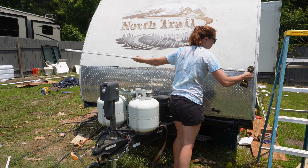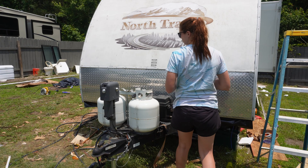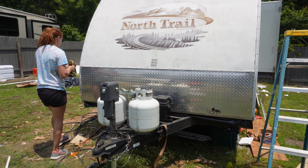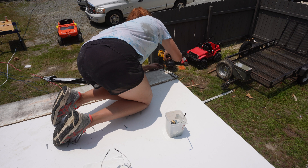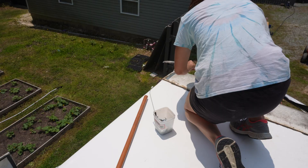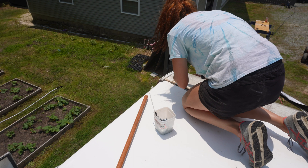For this middle piece, I forgot to film it, but I overlapped it just a little bit with the aluminum stud that was right there. Because of that, the trim sits a little higher and didn't catch the stud on the other side. So I cut a piece of wood to about one inch and put it in on the inside of the camper — that way when I put the screws in, they have something to catch into. If you line yours up correctly, that won't happen. Now I'm up at the roof, tacking in the last top pieces. I left one hole not screwed in because the screw trim cover is going to go underneath it and wrap back around.